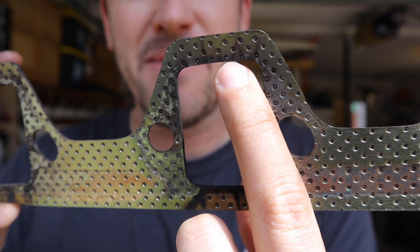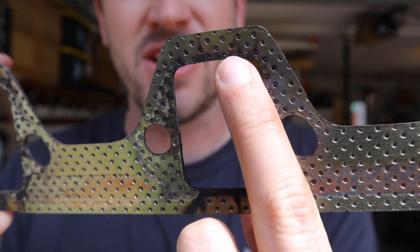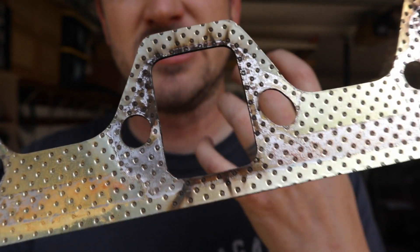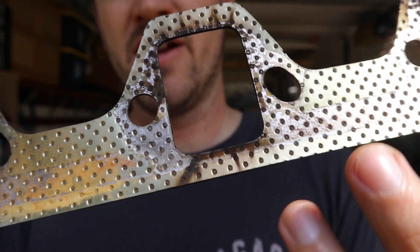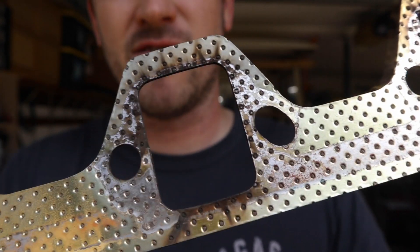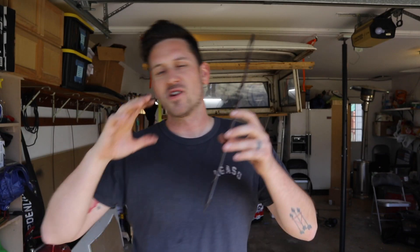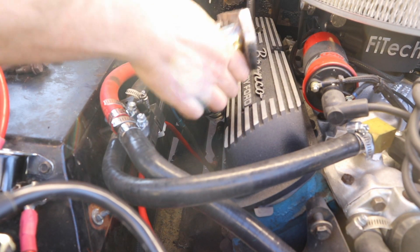What you see up here are like detonation marks — exhaust was still burning fuel essentially. I know I'm way oversimplifying this, but that's kind of what you're seeing here, these detonation marks. There are a lot of things that can contribute to what's going on here, and from the time I've been working on my engine and knowing the Fitech, when I put these header gaskets on — which was when I replaced my long tube headers, you can check out that video — things started going wrong.